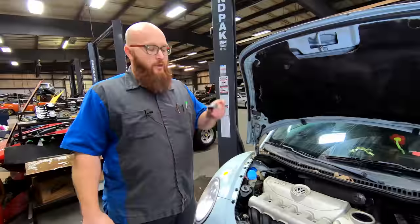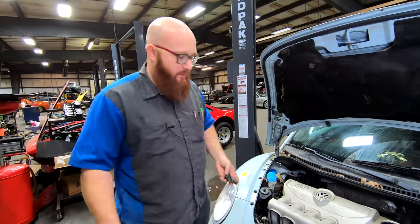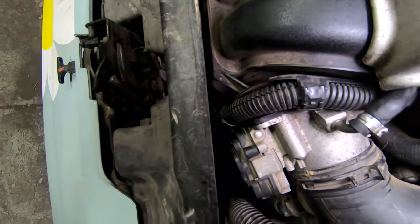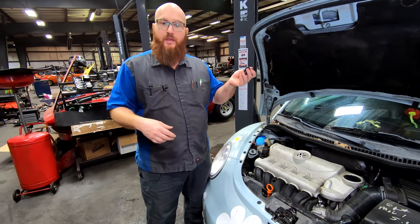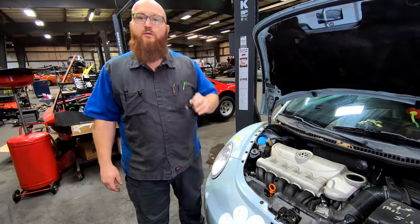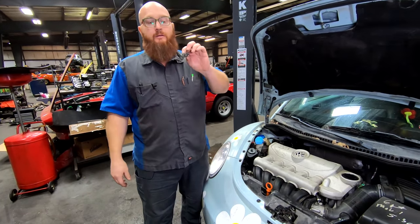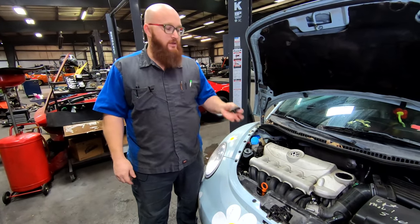Let's take a look around this engine bay. Here we have the bad manifold absolute pressure or MAP sensor. Straight down below my flashlight, right below it — you can see it's mounted down there. Kind of difficult to get to, but it wasn't too bad. This is commonly a confusion point for customers: MAP sensor versus MAF sensor. I frequently say 'your MAP sensor is bad' and they say 'I already cleaned it' — no, not your MAF sensor, your MAP sensor, like reading a map. Magic Mike measured the readings right at the sensor, it proved to be bad, we replaced it, and the code went away.